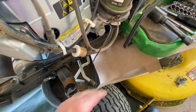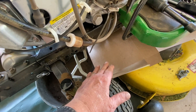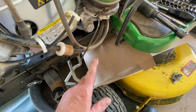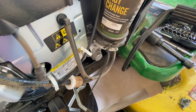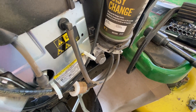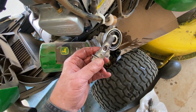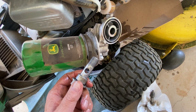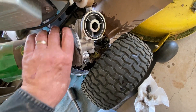I've got my oil pan and I fashioned a little spill tray with a piece of cardboard and it's going to spill into the drain pan. I'm going to take this bolt loose — it's going to remove the whole assembly out as one piece. I'm not going to worry with taking it all apart. Once you get the bolt out, your whole little filter manifold and filter and all will easily come off, and I have the catch pan under there so it caught everything.